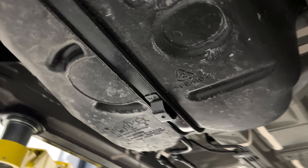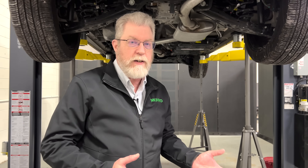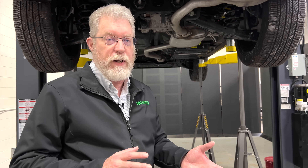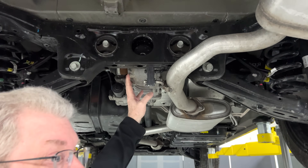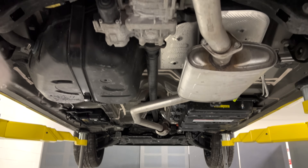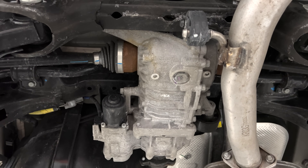This vehicle is rated at 34 miles per gallon combined. It does a little better in the city than on the highway, which is typical for hybrids — the reverse of your usual internal combustion engine car. Normally highway fuel economy is better, but in a hybrid you get better use of the electric motor in the city. So it's a little better than 34 in the city and a little worse on the highway. The rear wheels are driven mechanically through a differential with a shaft from the engine, and it looks like they have a disconnect system for reducing drag when you don't need it, which is a fuel economy benefit.